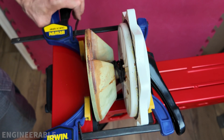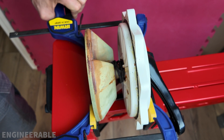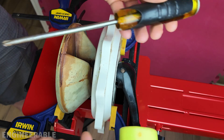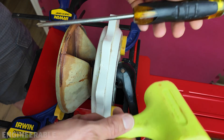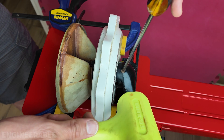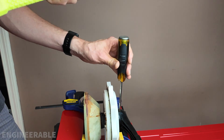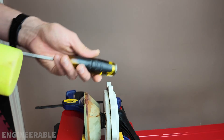You're going to need to use two clamps to compress the spring. This is with the old spring — it still helps to compress it down to be able to remove the pin. Using a sturdy screwdriver or a punch and a hammer, we're going to knock this pin out. It comes out pretty easily.